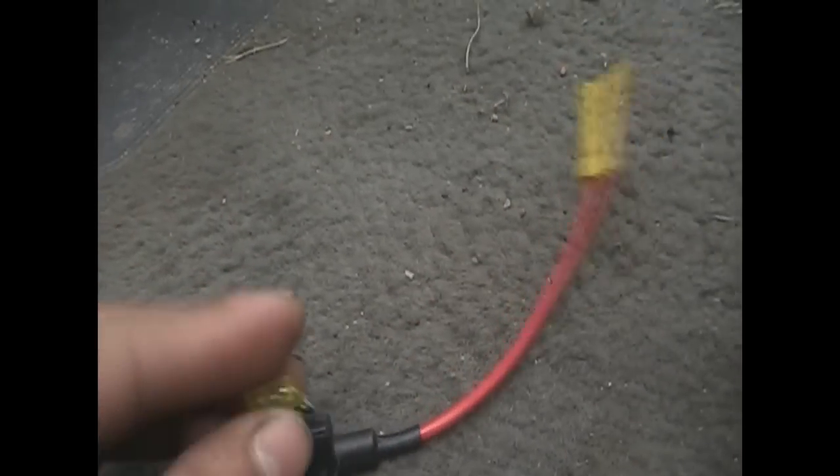For the other side, you need a fuse tab — a 20 amp fuse tab. Just go under the dash and take the 20 amp fuse from the fuse panel, and connect it to the fuse tab with another 20 amp fuse. Just like that, really easy. Then crimp the other end to the motor assembly wire.